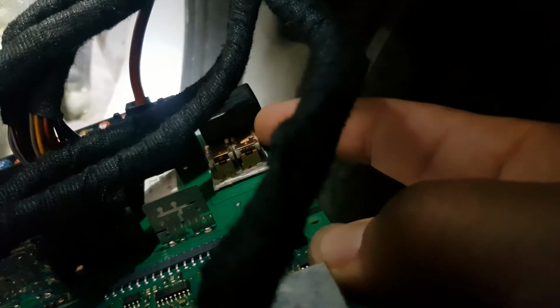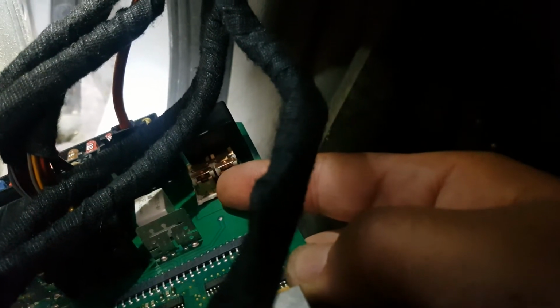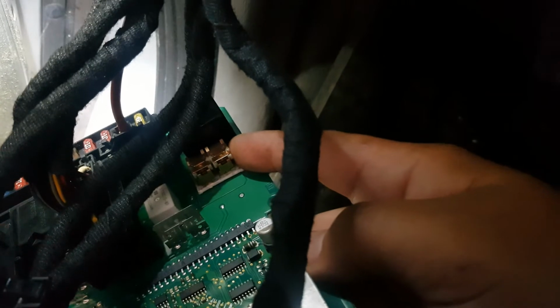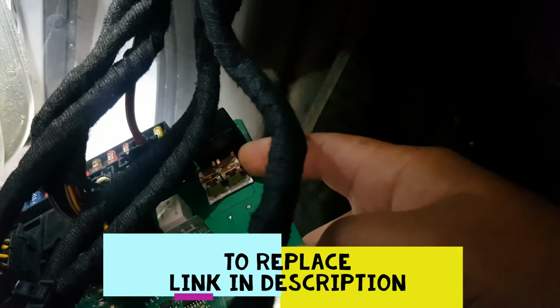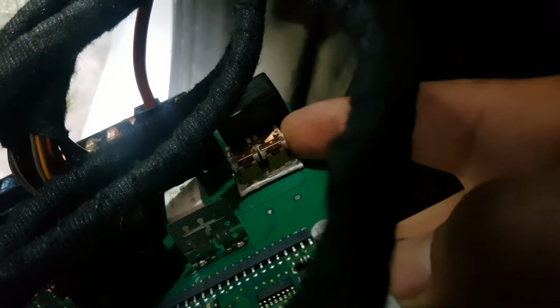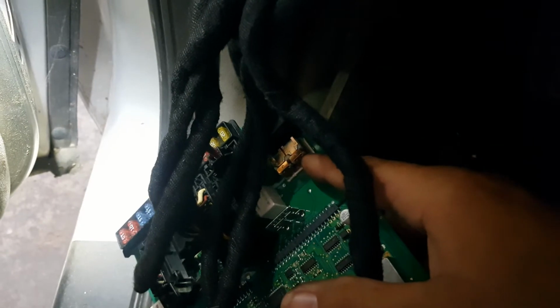I'll just put it right there, this one. So what happened was that wherever you had the sound, because the relays were clicking, but there was no contact passing from the top to the lower part. My advice is to replace this relay, but if you are in a country where you cannot get these, just clean them, give them a little bit of clean with a little piece of sandpaper, and make sure it makes contact. This is the module that sits right here.